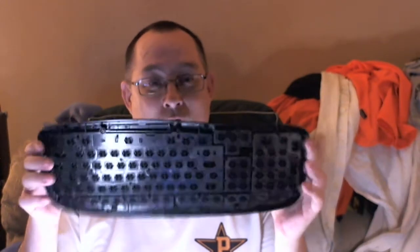If you have a messy keyboard and you've never cleaned it, maybe you found this video and it puts your mind at ease. When you turn it upside down, the keys don't all fall out — it really isn't a big deal. Take your time removing the screws and check the lengths. You may find some are slightly longer than others, so put them in separate cups or trace the unit on paper and plop the screws where they came out as a reference. Nowadays most screws are about the same length, so it's not a big deal. Just make sure it's dry before reassembling.